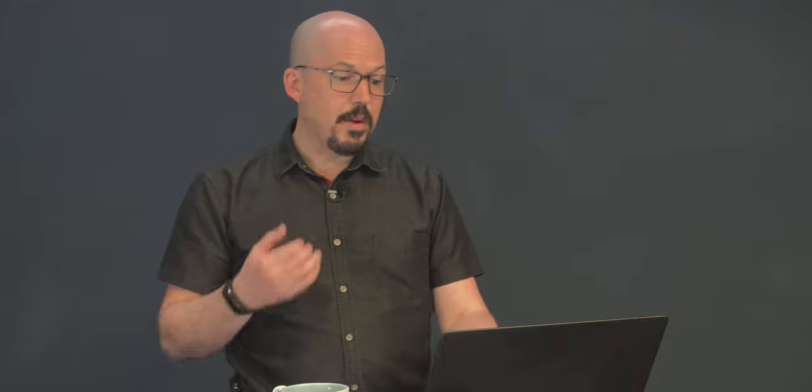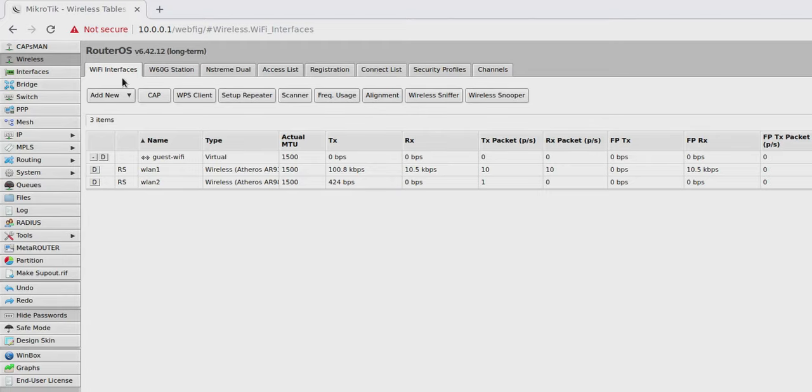Because I'm making changes to my Wi-Fi setup and my Pinebook Pro is connected to Wi-Fi, the router itself isn't rebooting — the internet isn't going down — but the Wi-Fi will hiccup because the Wi-Fi transmitter is restarting to reload those configuration settings. Now that it's finished reloading, you can see under Wireless Wi-Fi Interfaces there is one called 'guest-wifi', which is a virtual interface connecting to my Wi-Fi.